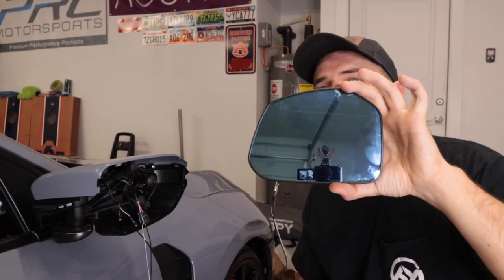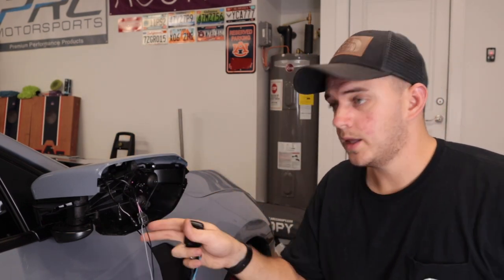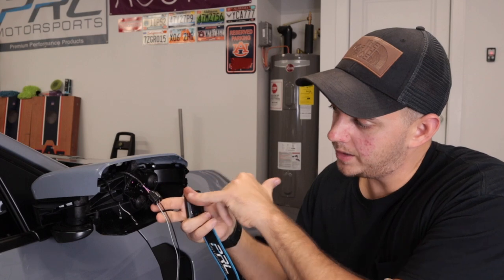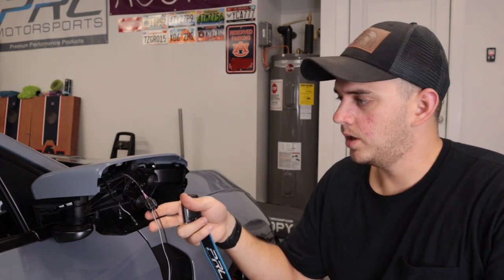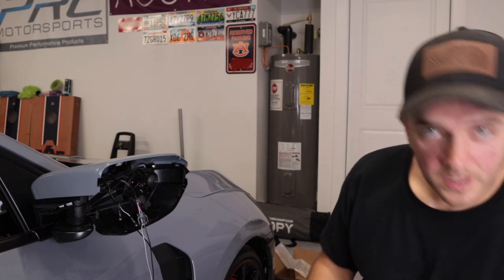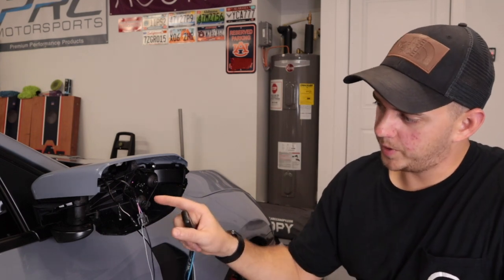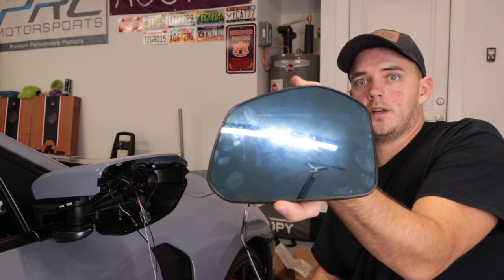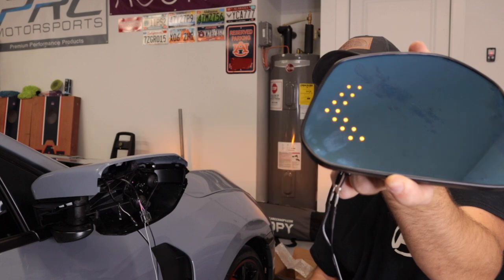Alright, so the mirror is now wired up. As you can see here, it now works. So on the connector on the mirror side — the solid black is going to go to the purple wire, and then the black and white is going to go to the pinkish one. And they give you nice little connectors to connect them. I'm not going to show you guys that — it's pretty straightforward. But like I said, black goes to the purple, and then the black and white stripe goes to the pinkish one. As you can see, the mirror is working just fine. It wasn't too bad to tear the mirror back down — only took me less than five minutes. And then I'll get to the parts where we fasten everything up and show you guys what it looks like. What an adventure, but hey — not everything on camera is always going to be perfect. Just know that.